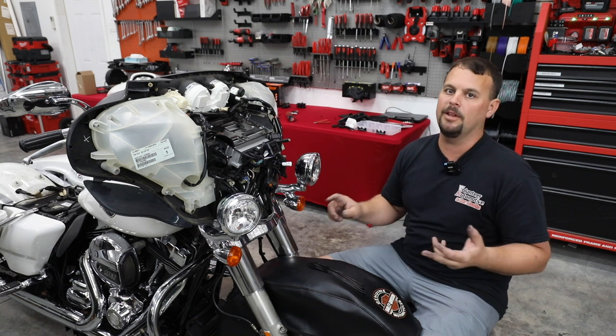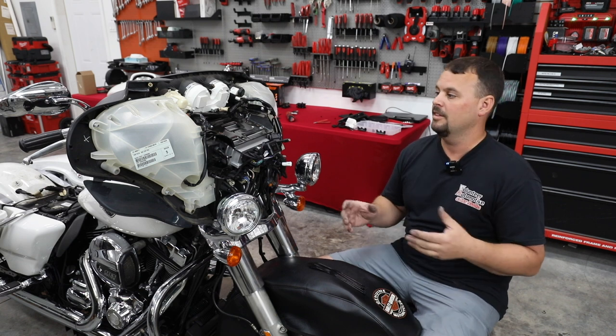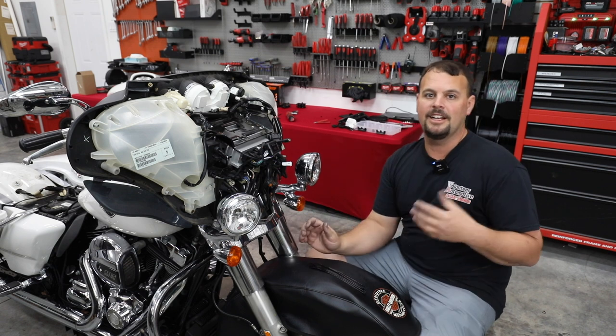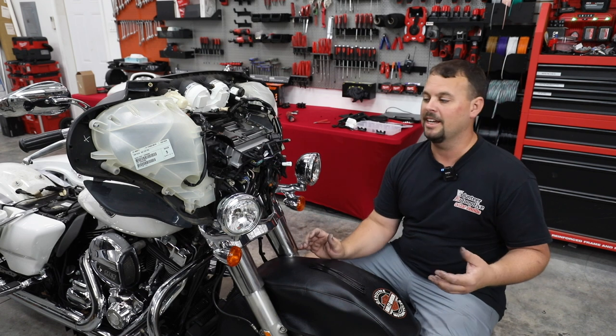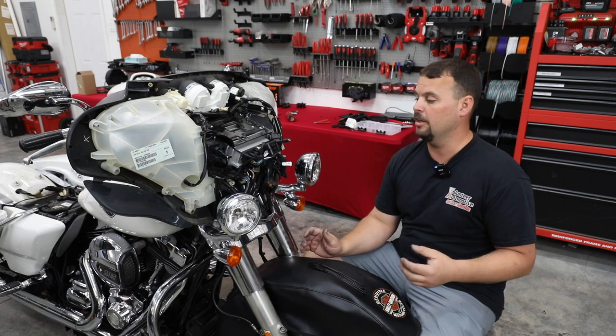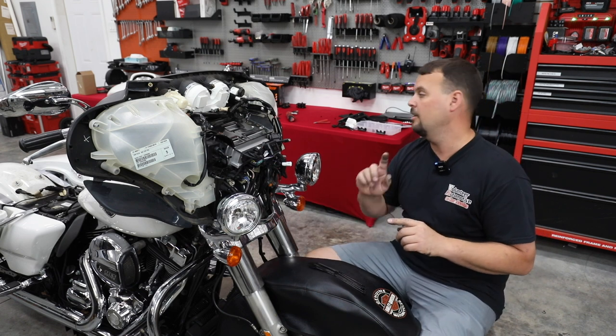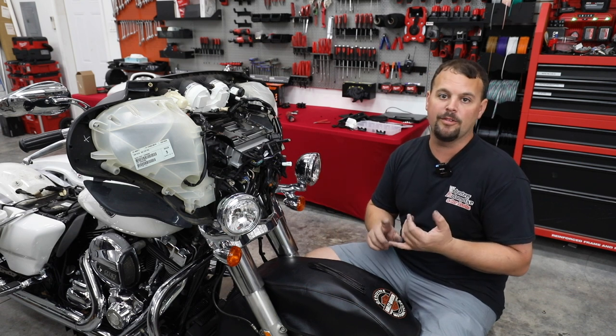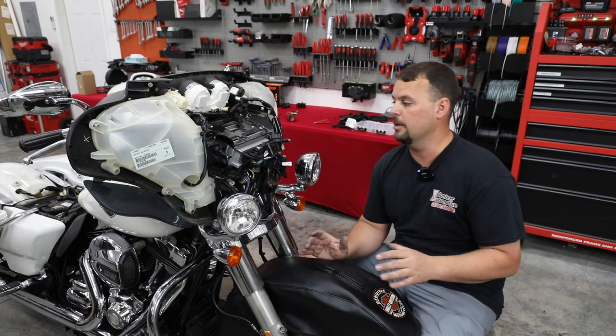I'm gonna use Apple CarPlay. I'm gonna use Bluetooth. I'm gonna use Sirius XM through those apps. So I'm not going to need an FM antenna for what I'm doing with the bike. If it's really important to you that FM works well, you need to run an FM antenna all the way to the back and put a mast antenna back there. It's further away from the things that interfere and you're gonna get much better reception.